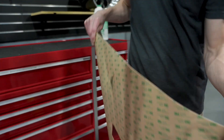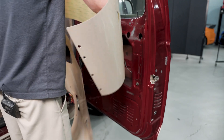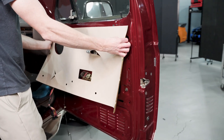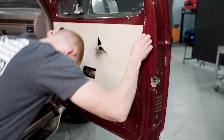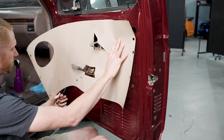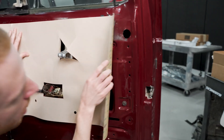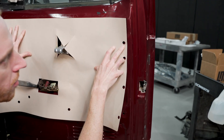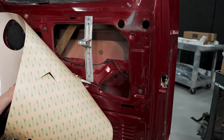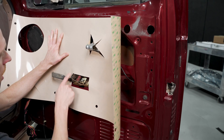We'll take them both over to the door — you'll want to hold up which one is which. You'll know which side has the adhesive backing. That one's going to be the driver's side; we'll set that one down and address it after we do the passenger side. Here's a quick general mock-up on the door skin — you'll have to feed it underneath the door handle. You'll also notice a few holes; those need to be lined up — that's where your push pins secure to the door skin for the door panel.